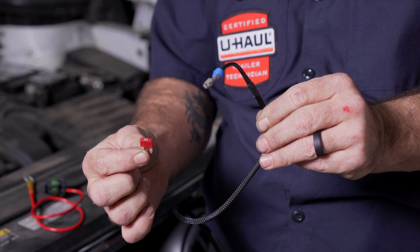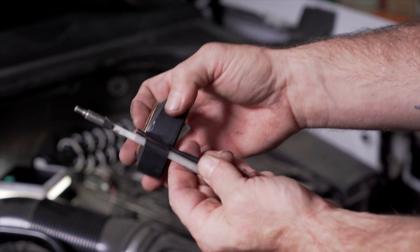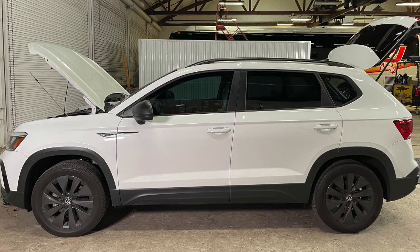Let me show you how we put those together. You will need to insert the power wire into the fuse holder — insert them until you hear the click. Tape your wire to your fishing pole, making sure you're taping the non-braided end. The best route to the rear of the vehicle is always your hard metal brake lines. Pass this through and get to the underneath of the vehicle, following the brake lines to the rear while avoiding hot parts.